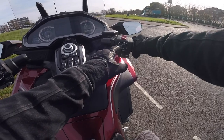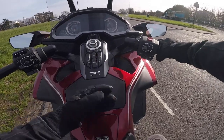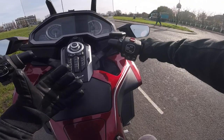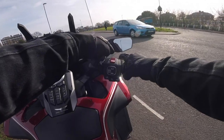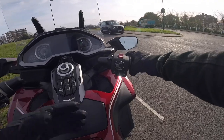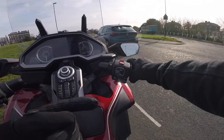This A slash M button here, that's automatic or manual — automatic being where it selects the gears for you. Manual goes into Tiptronic mode, where you manually select the gears, although there's still no clutch. It's a little bit like the paddles on a steering wheel of a car. Round the back of this switchgear, you've got the mode button, which puts it into a different riding mode. That affects the throttle by wire, the ride, and the damping of the suspension and the braking.